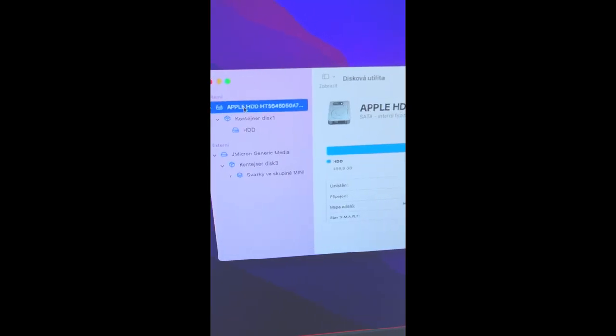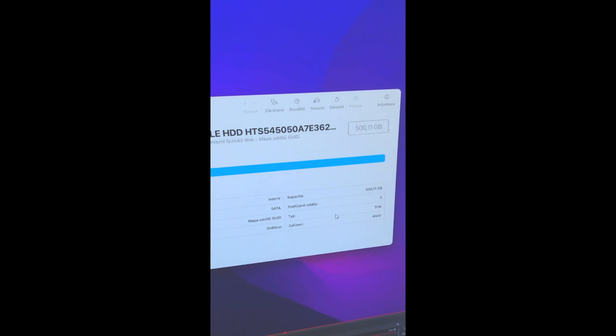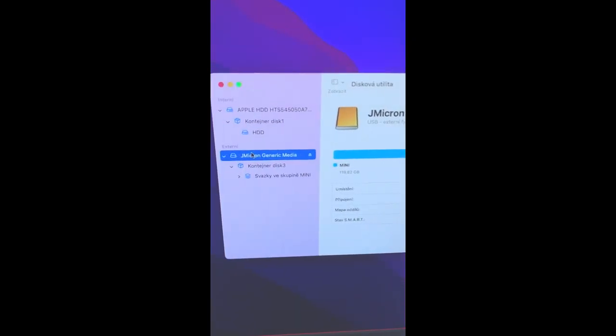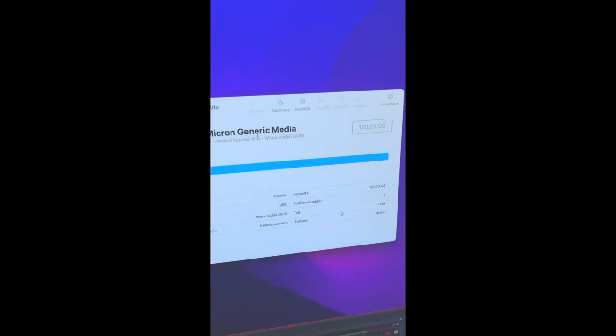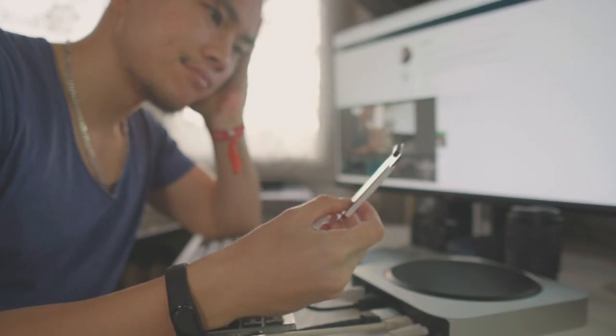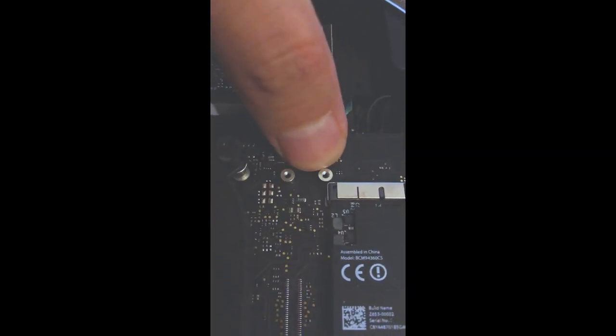macOS would just not recognize the new hard drive. At that moment, I regretted not buying a bundled hard drive so I would avoid any issues with compatibility. I was baffled and frustrated. Why does the SSD work in my Windows PC, but it is invisible in the Mac Mini? Why? I tried to format it to GUID partitioning, to exFAT formatting, but nothing really helped. So I disputed my order and failed again.